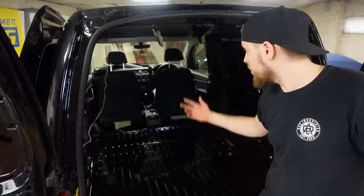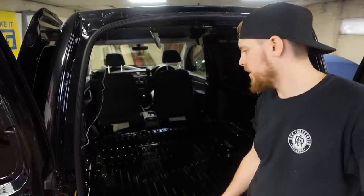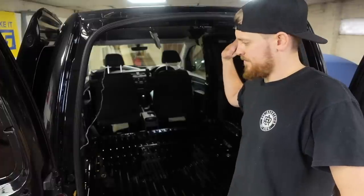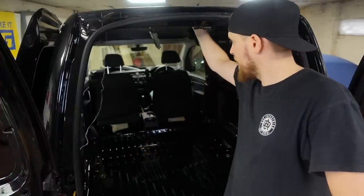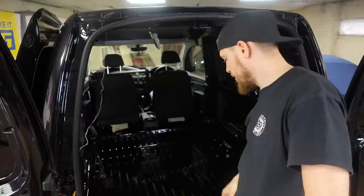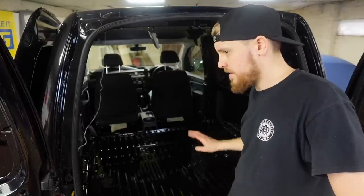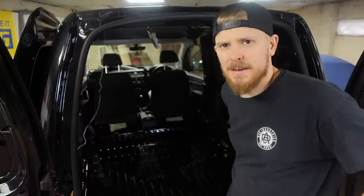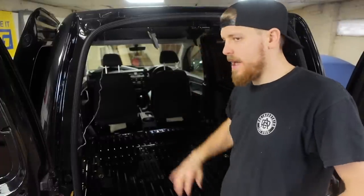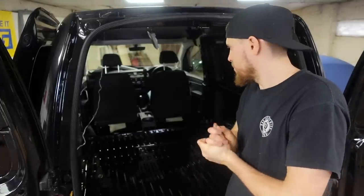There we are then. It's a bit dark, the lighting's not very good, but that's the inside all stripped back and stripped out. All the ply lining's out, the floor's up. All the hardboard panels are off the side of the van, the headliner's down, the B pillars are all down as well. So I've given it a bit of a clean over, but I'm going to go back over it with brake cleaner as I'm doing it, just so that we know the areas we're going to be sticking things to are completely grease free, and it's all going to stick.